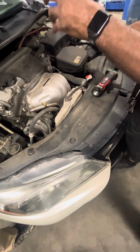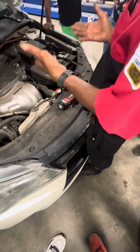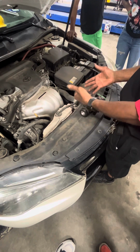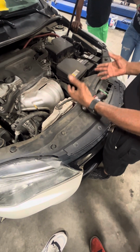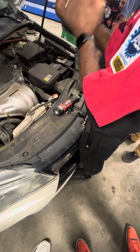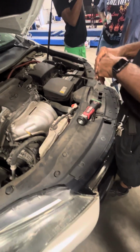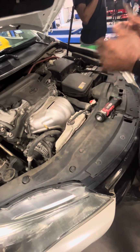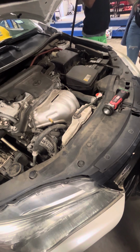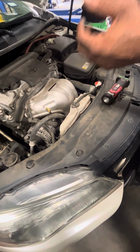Now, the top of the radiator, you take the cap off, you can see it's circulating. But what you can't see is how much of the radiator is circulating. My problem was that half the radiator was blocked off. The lower part was blocked, so there was no circulation in the bottom part, only the top half, which wasn't enough to keep the engine cool when it comes to a stop. The fan by itself wasn't enough. I changed the radiator, and the problem went away. That's why you have to know these test equipment, to do a thorough check.